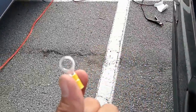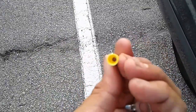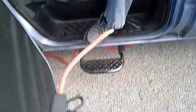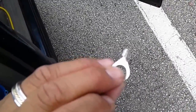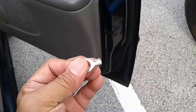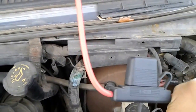I have this round O-connector, but the hole was too small for the cabling I need to hook up for my fuse. This is a fuse unit I bought from the flea market — it's a giant fuse. I removed one of the tips and busted the plastic off using pliers. What we're going to do is pry that part open and then clamp down on the wiring itself. See how I opened it up so it's wider? We'll put the wiring in there and clamp down on it. This tip is going to connect this portion to her red, and the other part will connect to the cabling we converted from the jumper cable.